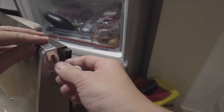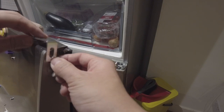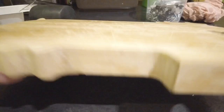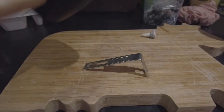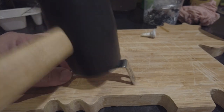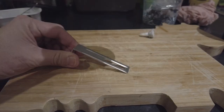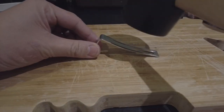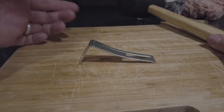The main issue with this bracket is that the hole is slightly too far out — it should be a little bit closer. So I'm going to bend it slightly so that the hole comes out a little bit. I'll use my chopping board and hammer it down a little bit with my mallet, hitting it at just the right point to get the correct angle. It's bent a little bit like that — I'll do it a bit more so it's an even greater angle.